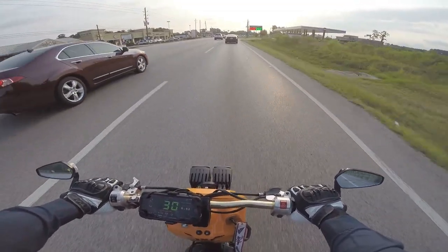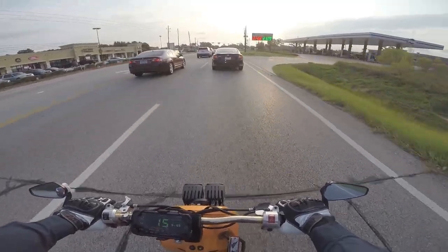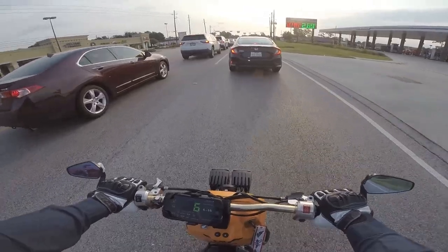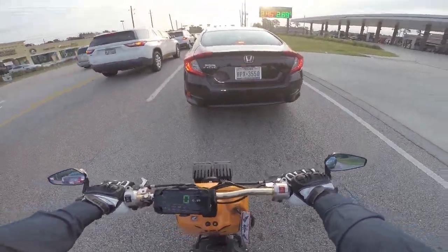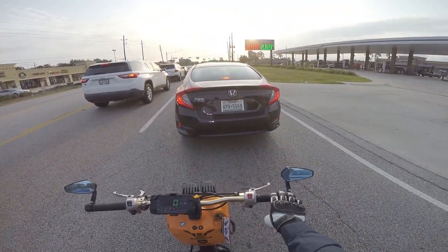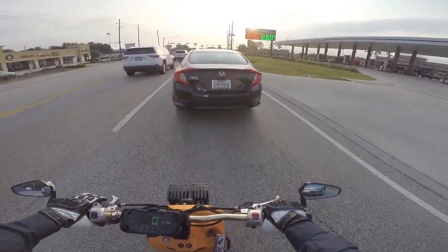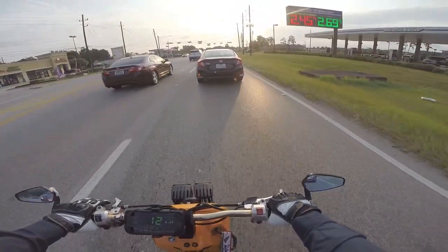The tickets are cheap. Second, foil in your sliders. Now, okay, I don't know about your rollers, because I don't know how that would work, since rollers roll. Well, I don't know, whatever. It might cause flat spots, especially if it's an uneven wear inside of the, it's an uneven roll. But anyways, foil in your sliders. Good alternative to micro-tuning your weights.